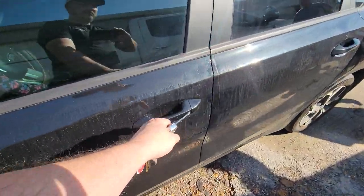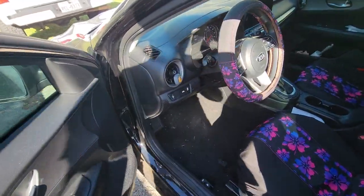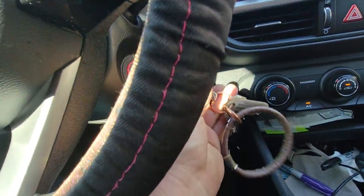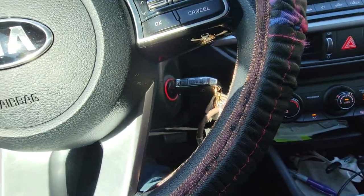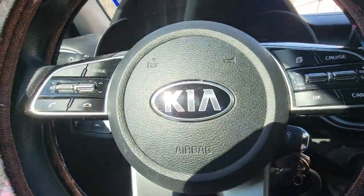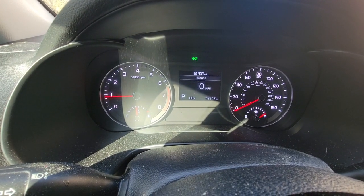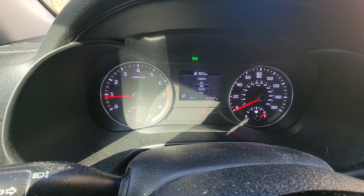Make sure you do not push the brake pedal until after you turn the key to the on position — two clicks forward. This system will make your TPMS light flash until you turn the key on and push the brake pedal.